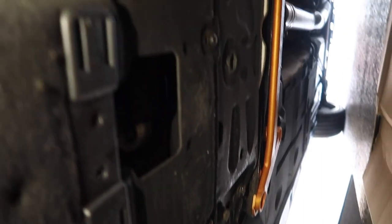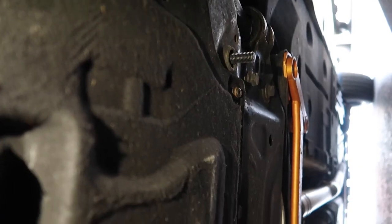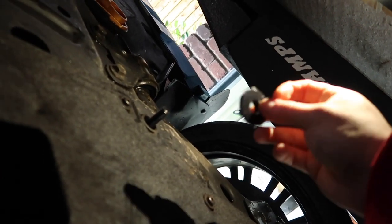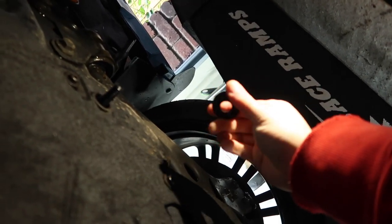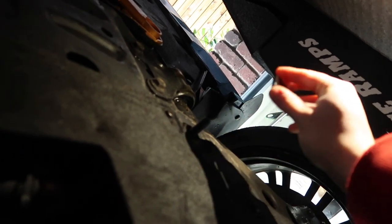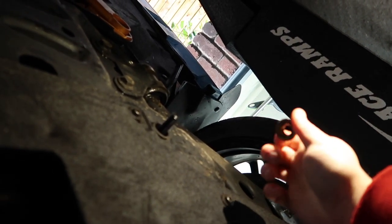At this point I have gone ahead and put the under tray back on — you can leave this to the end or do it now, it doesn't really matter, just do whatever works for you. We're now going to get our brace loosely attached onto our brand new bolts. The way this is going to work: we take this little black washer thing they gave us — one side is totally flat, one side has this inner section that's going to line up with the circle of this hole and sit up in there. So we're going to put that up there, then get the brace on, and then go washer and then one of these new nuts.